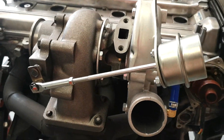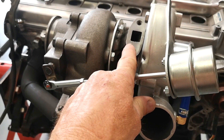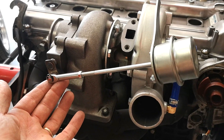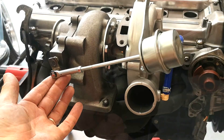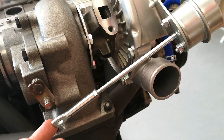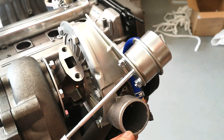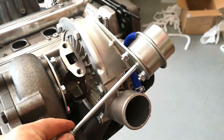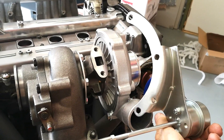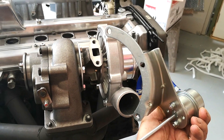I'm just starting to look at rotating the main compressor housing. I want to spin this so it's pointing down — I've undone all of the bolts on here and it's starting to move. I've just got to disconnect this wastegate and then I'll start to rotate it around and get it in the position I want. This little circlip went on to this pin to hold that wastegate actuating rod, and it'll start rotating now. I'm obviously going to move that wastegate around on these bolts as well, so I'll take that off so I can reposition it once I get the housing in the position I want. So I've now disconnected that wastegate and the whole turbo will spin — the only issue is probably the length of that bit of pipe and whether it will have the right length to reach where it needs to go. But let's rotate it and see how we go.